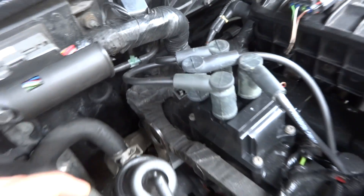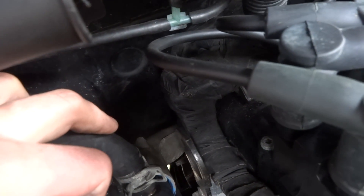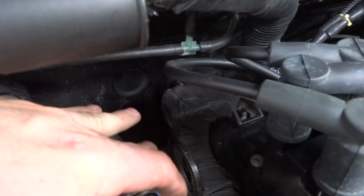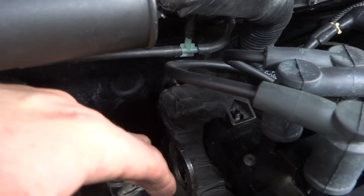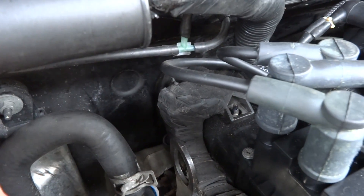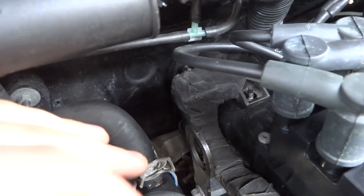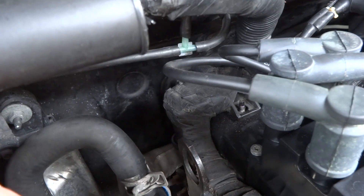On this engine there's an elbow on the back of the motor — it's right back there as you can see it. Check those and make sure it's not leaking. Kind of run your hand back there and feel for it. A good telltale sign for that one would be to look on the transmission and see if it's soaking wet with antifreeze or moisture — that'll let you know if it's leaking back there, maybe the gasket broke.